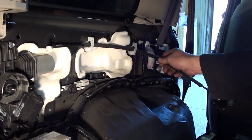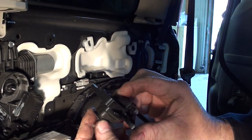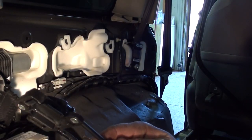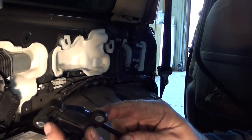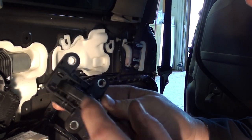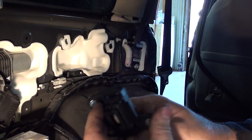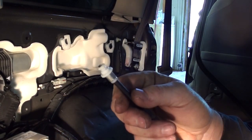I'm just going to pull straight out of these clips — same procedure. Just give the rubber a pull. This one's a bit easier, there are no tabs, it just sits on the outside. The front sheathing won't fit through very well, so we're going to take it apart. You can see there are tabs here and here — give them a squeeze and they just pop out. Same on the bottom. Now the cover is completely removed and you can remove the cable — remember where it went.